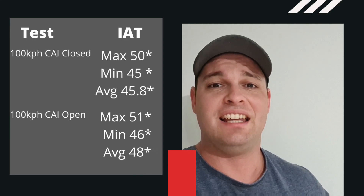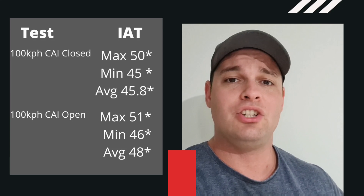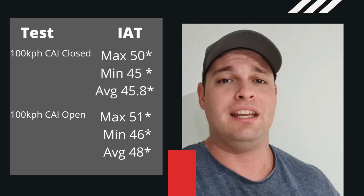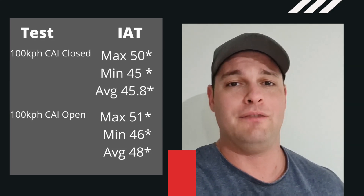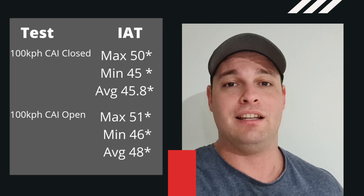I'll give you guys a second to look at the 100 km/h test. The IATs didn't seem to change too much, and that probably reflects the fact that the cold air intake isn't operating as effectively as it could be — which in my opinion is a good thing because it gives me something to improve on and take back to the strip. Unfortunately I couldn't test it at more than 100 km/h, so going down the drag strip at 200 km/h I can't give you any information on that. But I think it needs to be improved — anyway, have a look at the data and let me know what you think.